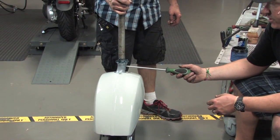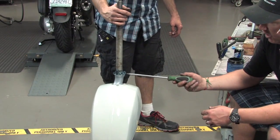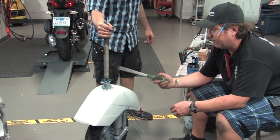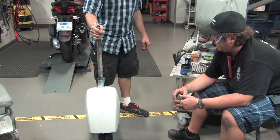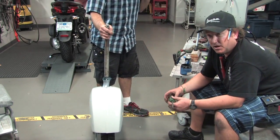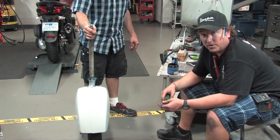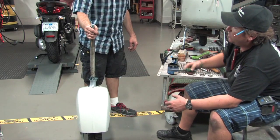The fender goes on first. Now it would be time to install the lower grease cup — part number 01-92-64 — and then the lower race. You pretty much always have to buy new dust cups because in order to get the old fender off you pretty much have to destroy them drifting the race up. As far as the steering bearings and races, part numbers 152023 and 152024 are complete steering bearing sets — you'll get both races for the lower, both races for the upper, and the bearing for the lower and upper.